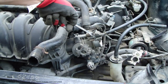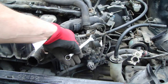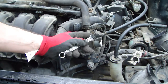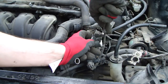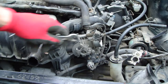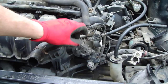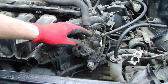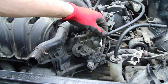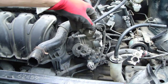This is like double locking in that position, in this way. Then we open only that nut in here, and I insert that in here, then I open that bolt and rotate. The idea is to rotate this bolt to the end, and here is again Toyota's Poka-yoke idea so that this wire doesn't go out. But when we move that in this direction, then this wire opens.